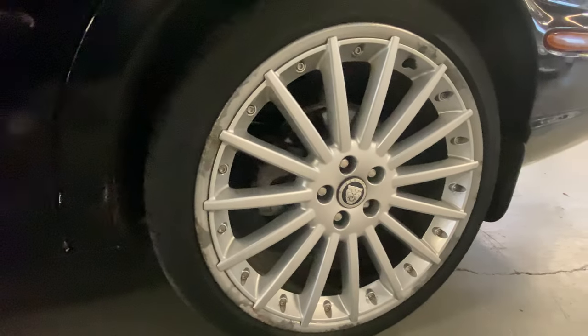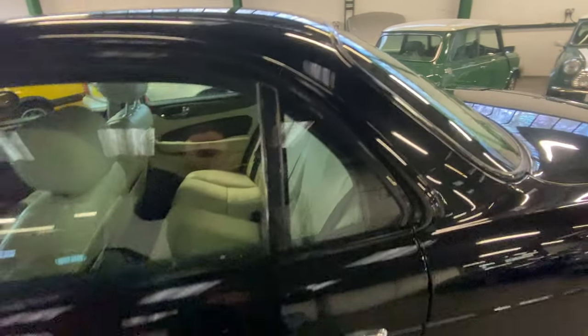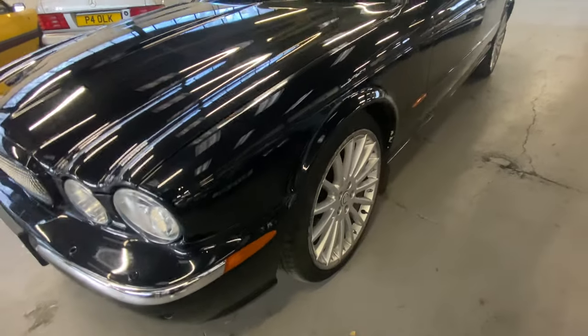It's got a good shine on this one, no real scratching around the handle. The top half of the left-hand rear door is all okay. As you come down the arch, have a look at the sill - a few little marks on the rub strip there. The wheels want a refurb. Across the bottom of the passenger door looks alright, got a little bit of polish stuck in there. The rest of the rub strip looks okay, the top half of the doors all nice and tidy, all nice and straight. The roof on the left-hand side is nice and straight. We do have some light surface scratches throughout from washing. Coming around the arch, some stone chips where the paint's come away a little bit. Wing tops all nice and straight and level down the left-hand side.